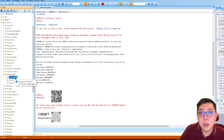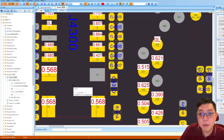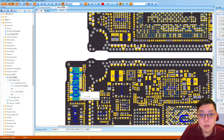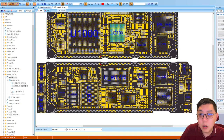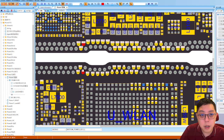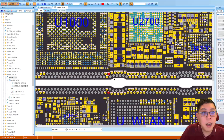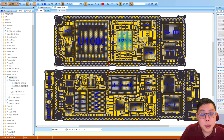The following case is an iPhone 11 to show you why some repairs cost much more. From iPhone 10 onward, the motherboard is separated into an upper board and a lower board. On the iPhone 11, the power button connects to the lower board and goes to the same type of component as before. But since the CPU is on the upper board, the signal passes through the frame interposer to the upper board, then to the power IC, and back to the CPU. This design makes repairs more complicated.